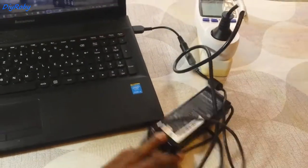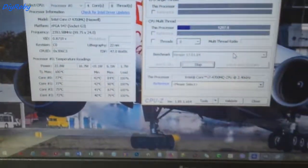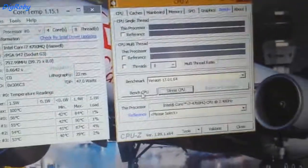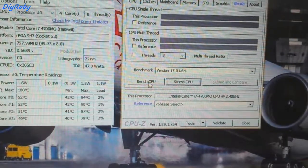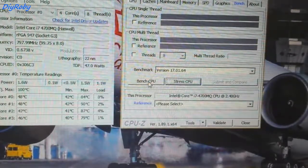So I found the solution for my over-65W requirement for the quad-core, but I'm now facing a new problem — throttling due to heat. I'll update in the coming video on how I solve this. I basically have to undervolt the CPU to reduce excessive voltage and therefore give off less heat. I'll also need to modify the heat sink and cooling system, because the heat sink made for the i5 just can't deal with the sudden burst of heat from the quad-core at high speeds.